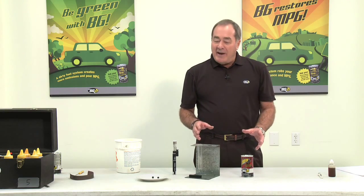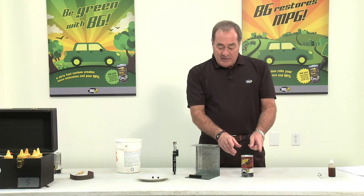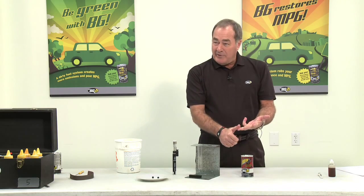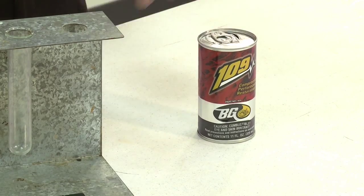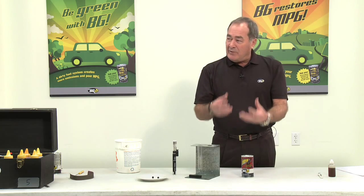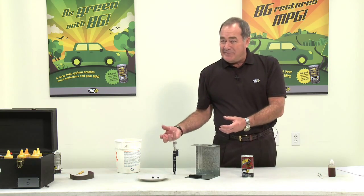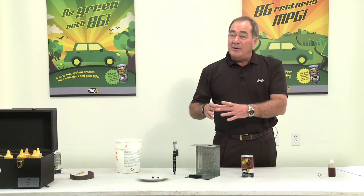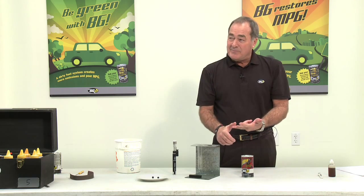What I'm going to do today is demonstrate the effectiveness of BG products. We're going to start using our cleaning products, 105, 106, 108, 109. We're going to show the demonstration with product number 109 because this one will cover all of the soft areas that 105, 106, 108 cover, but we're also going to do the hard deposits that form inside an engine around the rings. These are hard carbon deposits, so we need a different formulation from the 105, 106, 108.